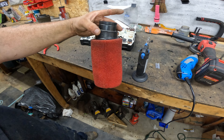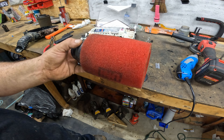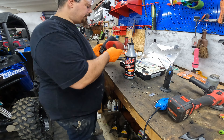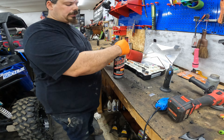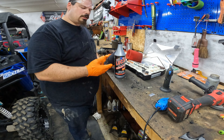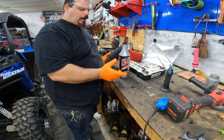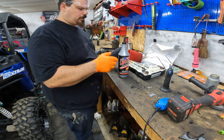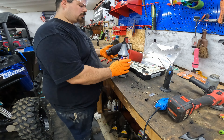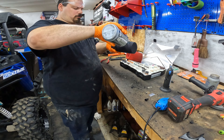Now we've got that smoothed out, washed out, and cleaned out — she's good to go. We've got to oil our uni. Remember, this is a UP6229 AST uni. We're going to undress our uni now. I like Lucas foam filter oil; I also like Maxima oil filter cleaner and oil. I bought this because it's actually cheaper than Maxima — you know me, we operate on a budget.